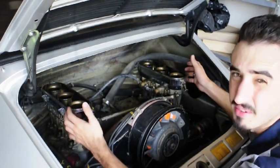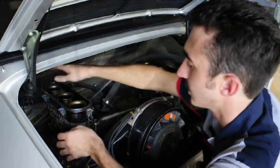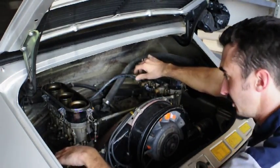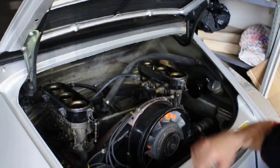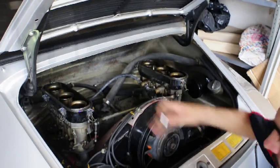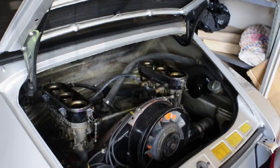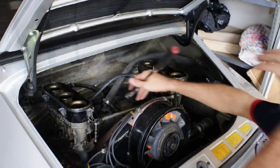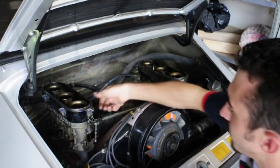As you can see right here is your fuel line — it comes in and splits off to both carburetors. There are little brass washers on these fittings; brass washers on these things tend to leak, so you're going to want to replace those. Grab an 18 millimeter wrench and remove them. These were not tight at all, which could have been part of the problem.